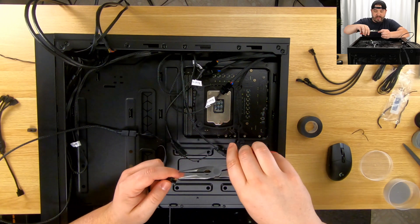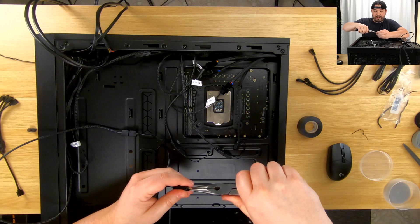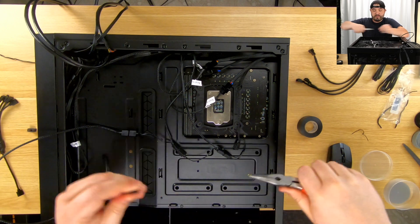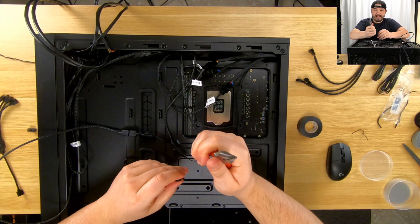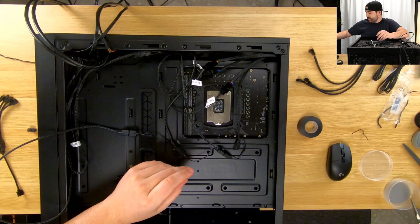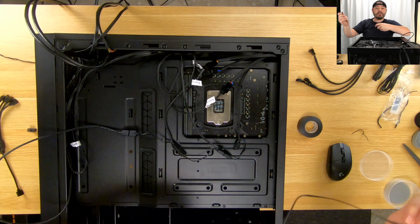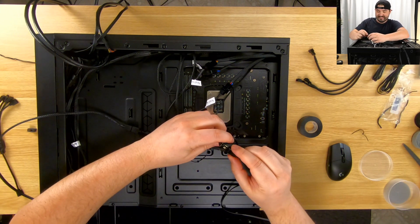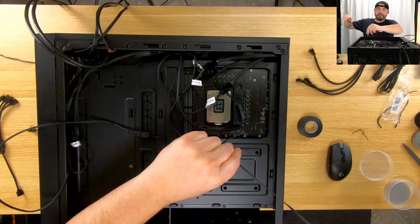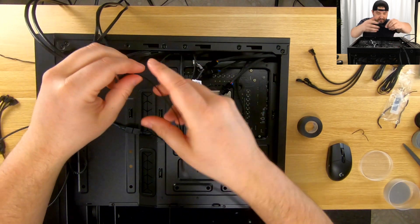What I'm going to do is take this and break a pin off, because if I don't break a pin off it physically won't fit — it only has three holes and we need four. I'm going to take the one right beside the power plug which is the G pin and attempt to pull it out. There we go — we want to save that. This should work. We'll plug in the three — it fits but is very loose, we'll take care of that — and then this is going to go into the top of the motherboard.